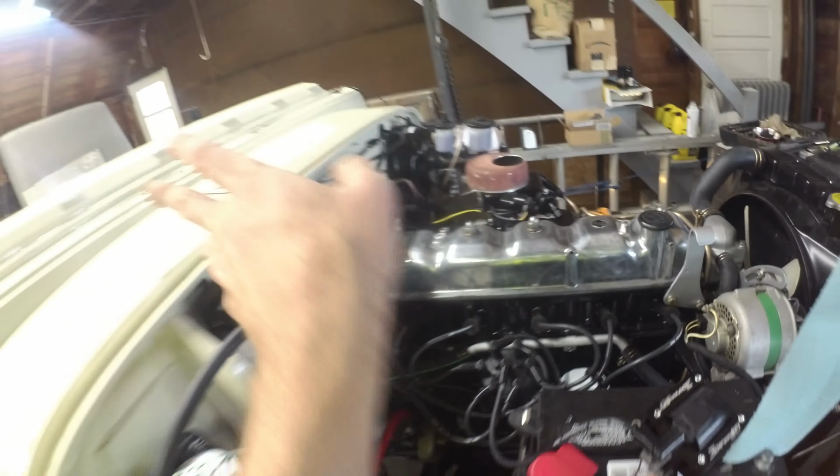Had to put a new little rubber bumper, just a different size. I think there's a little bit more of a lip on this gas filler door than factory. So I needed a longer nub, and then I had to push this guy back. But that's not too bad. Ended up replating these guys, threw them in the zinc bath, and then gave them the yellow cad kind of look alike.